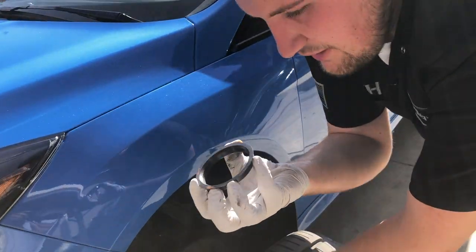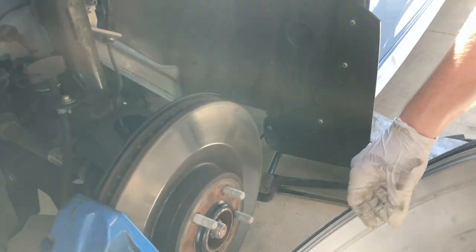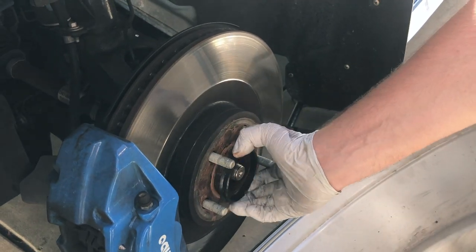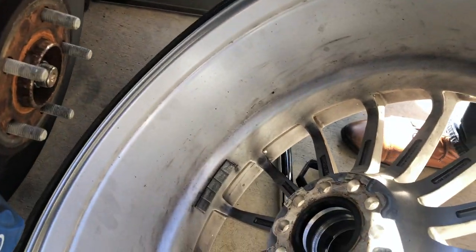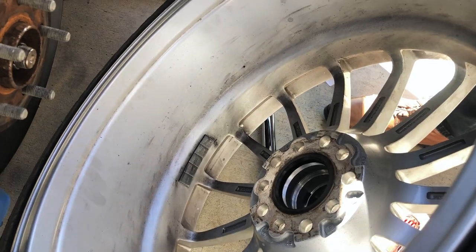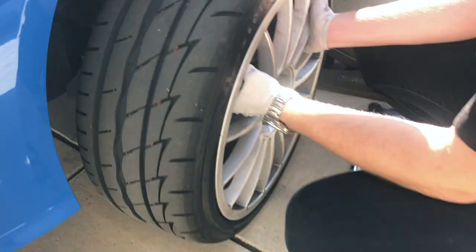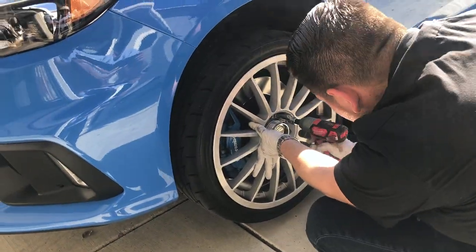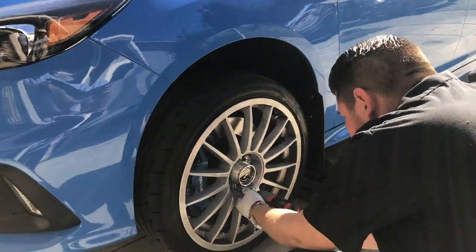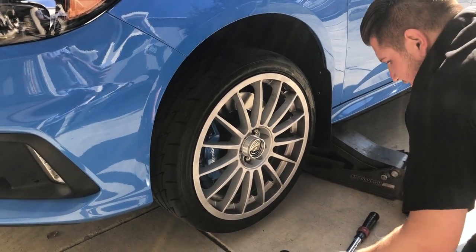Here's what we're talking about — see, this ring fits perfectly on the hub, and it fits perfectly in the wheel. That gap was causing the vibration I was feeling. Put the wheel on and it's usually easier to go hub first. The lip on the ring helps it go on easier. We're going to set her down and torque them up.